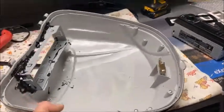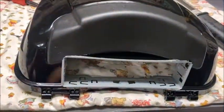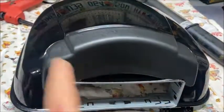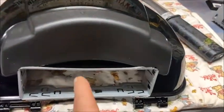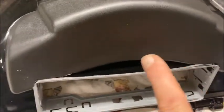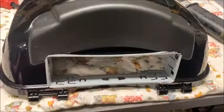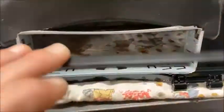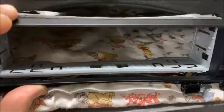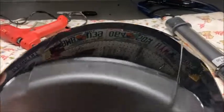Next, I took the sleeve and mounted it in there. Then I took the extra piece of fiberglass that I cut from the radio hole, modified it, made a straight edge, and slid it in so that you have a textured ABS surface and then a gloss edge — giving it a custom look and fit. That goes in there like that, and then of course you'll have the trim ring. I'll mount the sleeve and the radio — this is going to be sweet — and then on the back side...